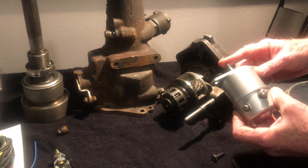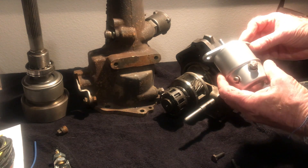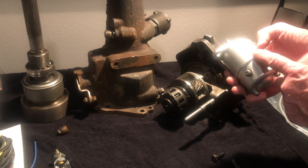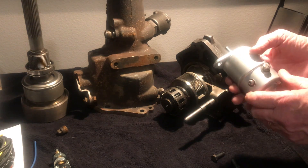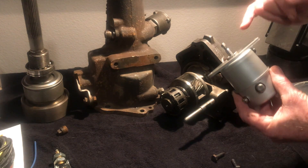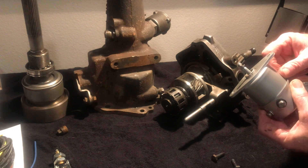When you have these out on the bench, don't push the shaft down because you'll bend the little points inside. The purpose of those points is to switch from the coil that pushes the shaft out to holding the shaft out — so there are actually two sets of coils in here. It's a heavy duty piece; most of them have a one-inch shaft length, measured from the alignment flange to the tip.